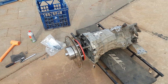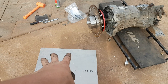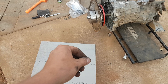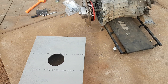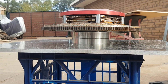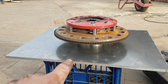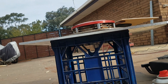I've got all that bolted up. Now I want to try and put that lot in there, put the bell housing on top, get the gearbox in, lined up with everything and the bell housing on — pushing everything onto each other, and it will centre everything. Then I can copy the bell housing onto this piece of metal. The plan is to bolt this to the bell housing, and do the same thing with another piece to the engine, then bolt the two pieces together. Hopefully I don't stuff this up — there's about $100 there in metal. I'm using Emily on the crane — hooked it up with some ratchet straps to get the input shaft past the top of the bell housing and lower it down into the clutch.